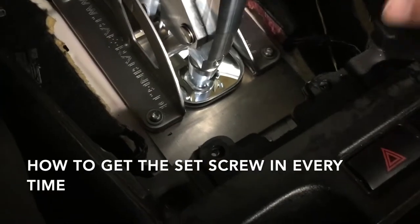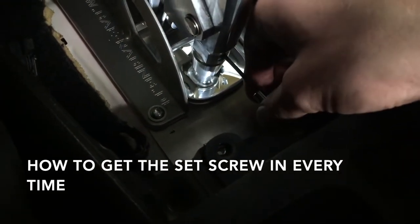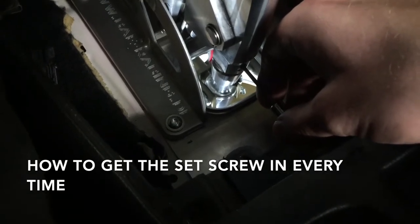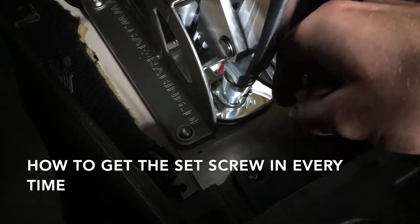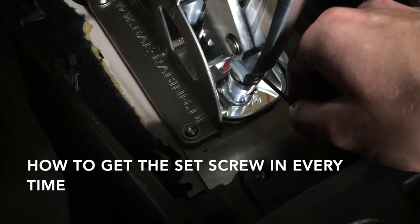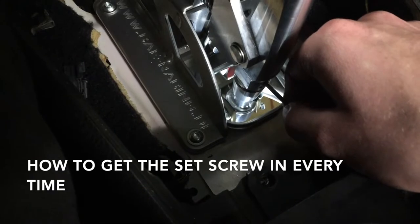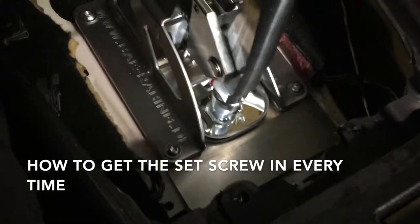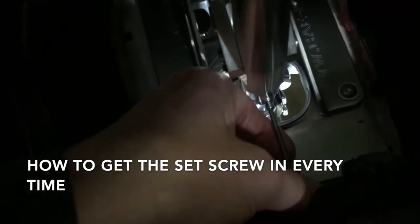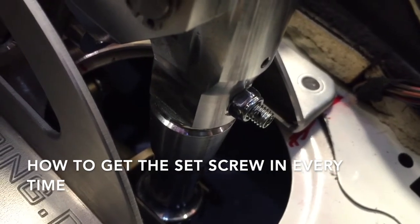If you're having problems inserting the set screw and finding that groove or dog on the lower rotating assembly, what you should do is take a thin allen key, put it through, and have somebody else slide it up into the lever. You'll feel the lower rotating assembly touch the allen key. Then take it out, slide it up a little bit, and you'll feel a stopping point — that's your lower rotating assembly. Very slowly push it up and you'll feel where it can suddenly go in a little further; that's where the groove is for the dog on your set screw. Using that technique, you'll be able to get the set screw in and the shifter linkage is going to feel nice and solid. You can see the set screw is all the way in and the nut is on the lever, so we know it's in the groove. Keep it just finger tight for right now — we're not locking anything down.